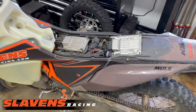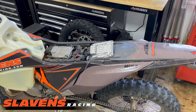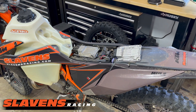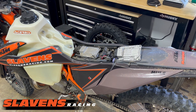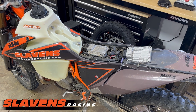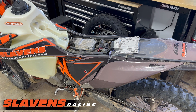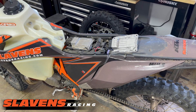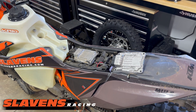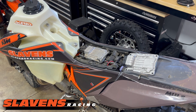Back to the ECU reflash — what we've accomplished here is fixing what the factory did. The reason they came out with fuel injection was to try to make the bikes pass emissions tests in the US and Europe, and in that process they made them too lean in a lot of parts of the power band. That's part of the starting problem, the pipe bang issues, and the low performance that guys complain about saying their carb bikes ran better. Well, when they're reflashed, they are strong — just as strong as any correctly carbureted bike — and pull smooth everywhere.